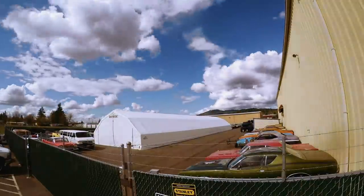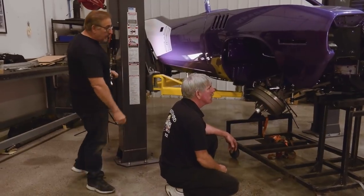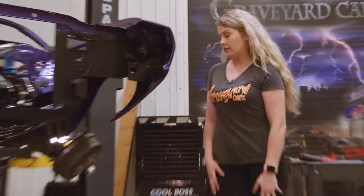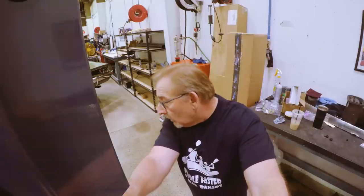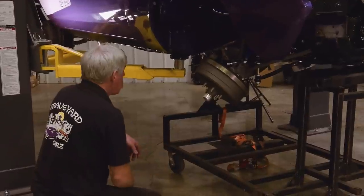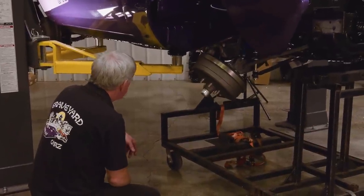Okay, so you guys got the bolts tight then? Yep. I'm okay to raise it up? Yes. Everybody out from underneath it? Okay. I'm gonna raise it up, so I'm gonna put the transmission crossmember bolts in. Okay. Oil pan should rest on the drag link. I put a pad in there, so we should be golden. Anything look weird? Nope. Great.